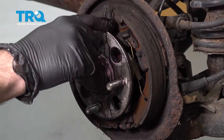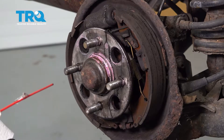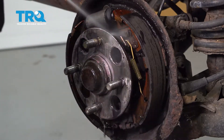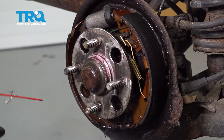We've removed our brake drum and it is coated in brake dust. You don't want to breathe this stuff in. Put some pads or a drip pan underneath, use some solvent, and soak it down to clean up all the brake dust. Put a mask on or cover your mouth and nose before spraying.